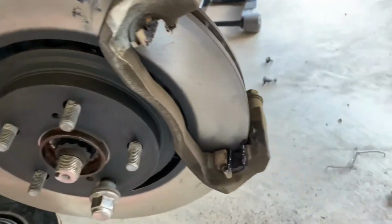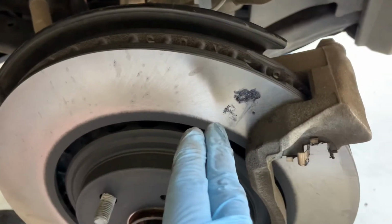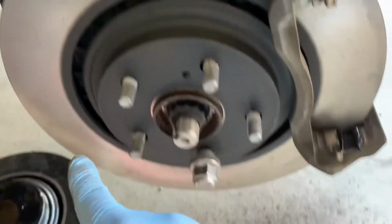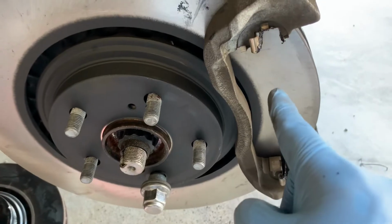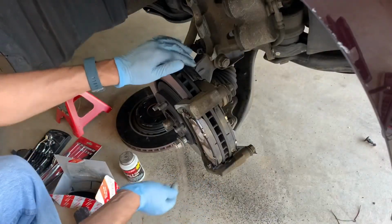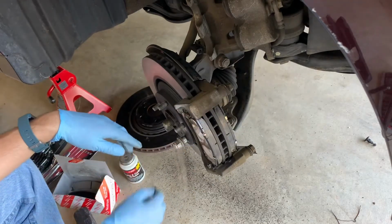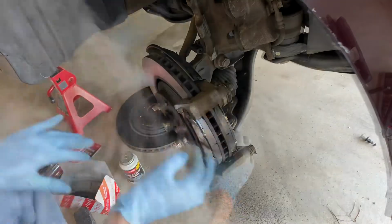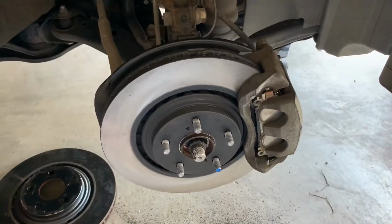Now before inserting the brake pads, this is the final stage to remove any grease or other debris or greasy surface from the rotor. So I've inserted the pads in. The wear indicator is on the top on both sides. All done. So this side is done. Now moving on to the other side.